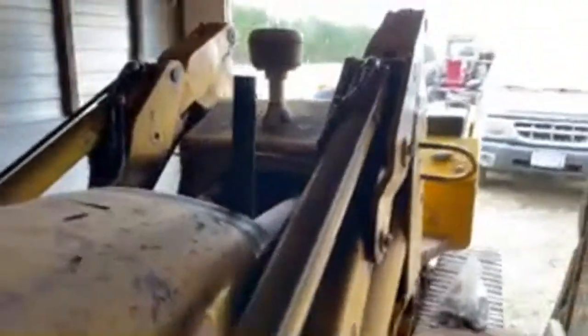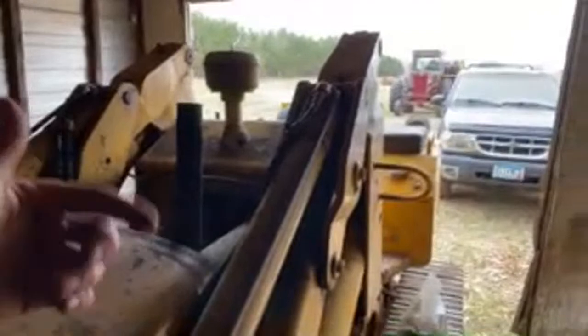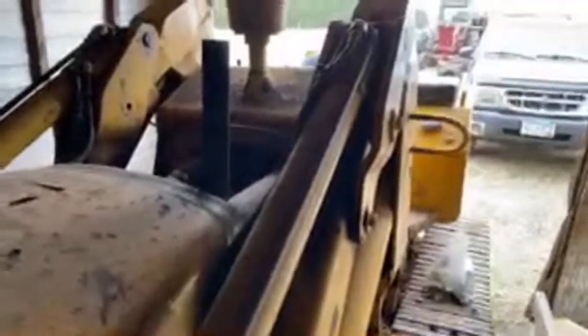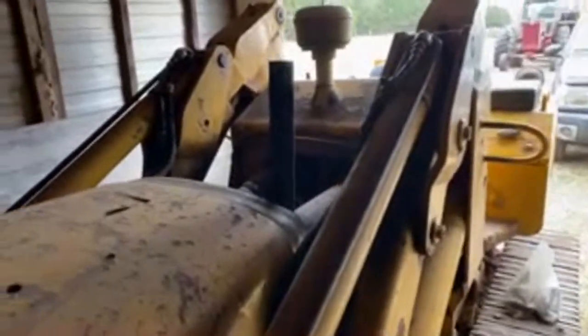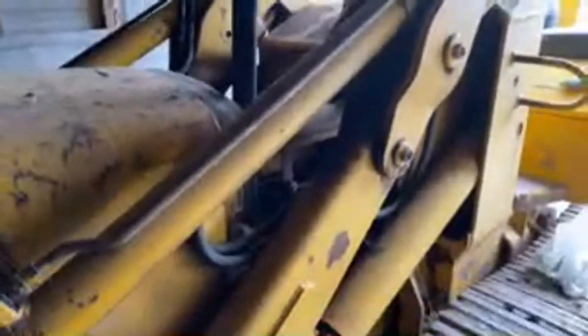So when you start him up, he likes to go full tilt, probably because it's sucking. Jeez, just about fell over. I'm thinking what's happening is it sucks air from that hole and pulls it back, and then drops it down into the cylinders or something like that, and it kind of gives it a shot of lots of fuel when it first starts. But also, after you get it running, it leaks a bunch of fuel. So we have to go through and replace that one of these days.